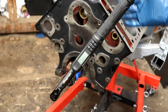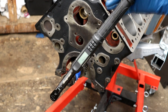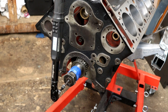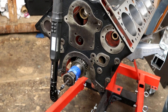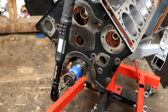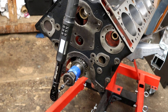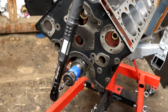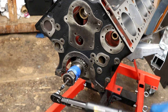We've got all the pistons in with regular light oil on the bearings and in the bores. Let's check the breakaway torque. We were at about 11.5 foot-pounds before — with all eight pistons in it looks like we're at about 11.6 to 11.8 foot-pounds to get the whole thing turning. Just over 11 foot-pounds with all pistons in — I'm pretty happy with that.